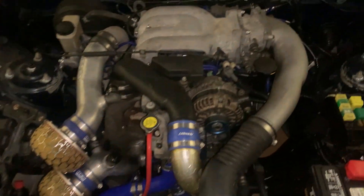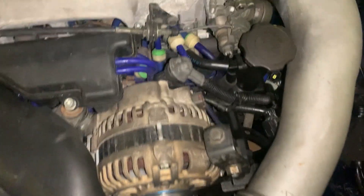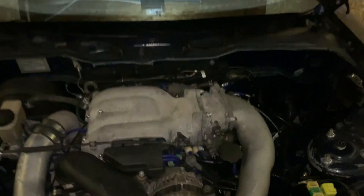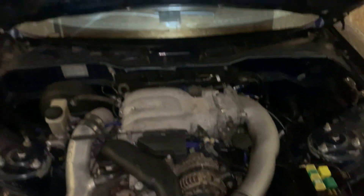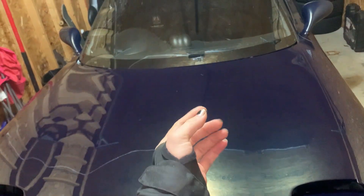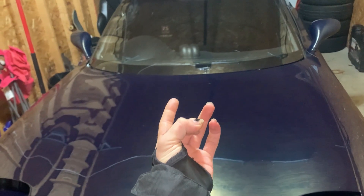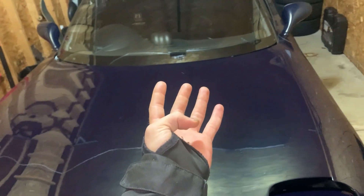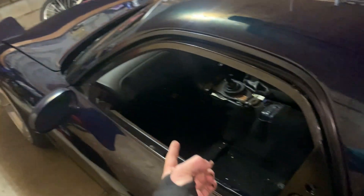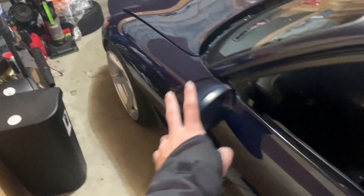There's one more thing I'll be doing later in this video — this little screw right here can readjust my idle, so I'm going to mess around and see if I can get it correct. I also saw a way to adjust the throttle position sensor, but it's very complicated — messing with one wire, then another wire. So those are the two things I'll be dealing with: getting the car to idle better and getting the pop-ups and brake lights working.